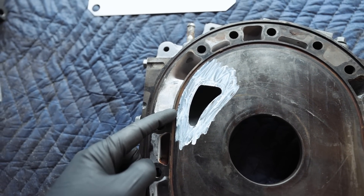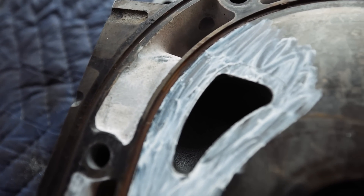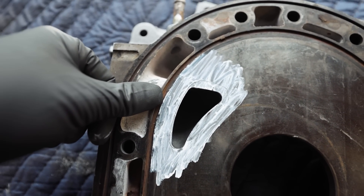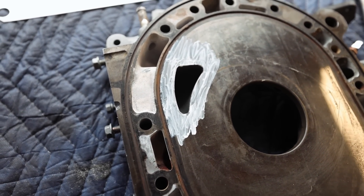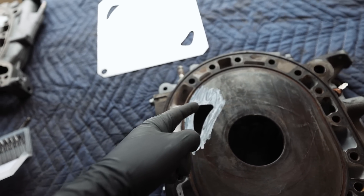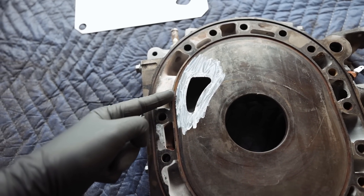On the front and rear iron — this is the rear iron — this gets the bridge, which is the secondary port here that I've already scribed. You can see it has a secondary port right there. We're going to drill some very small pilot holes to get started. We need to be very careful in this area because there is a coolant seal right next to it. The other port will be easy to open up, but that bridge is going to require care. We'll dimple it to start the drill bit, use very small drill bits, drill a bunch of small holes, then use small pencil tools. I'm going to start with the actual pocket porting first to warm up before attempting the bridge.